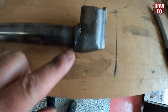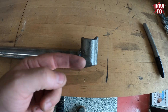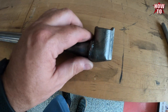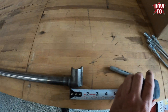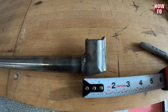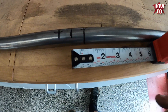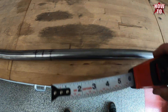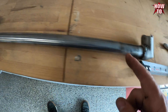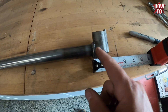Alright, we'll try this again. So we're going to try and cut like half this weld to see if we can't get the sleeve — the one inside here a little bit — so we can fish it out. That way we can have a more rigid joint rather than a butt weld. A little measurement. We're looking at three-quarters of an inch centered for that cup. Now obviously this would be flush, but if there's an inset here, we're going to find out how much that tube goes in before we decide to cut. It might sound confusing, but we don't want to cut yet.